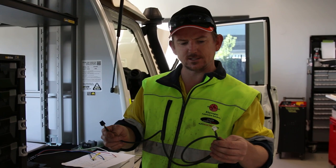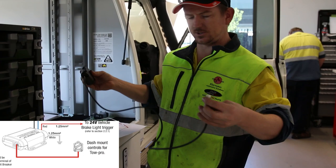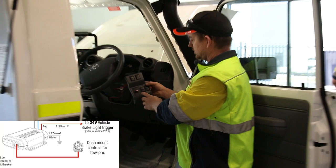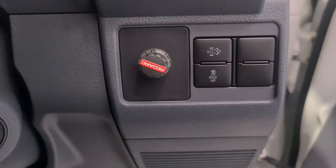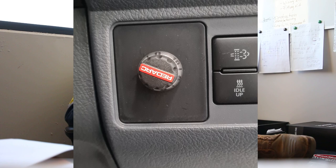That's basically all there is — four wires. On the other side you've got your hideaway dash connector which connects straight into the other side of the unit, clips in like that, and then that unit plugs into your dash dial which just goes into the unit here. It's all hidden away, and then you've got your dash display where you can set the brake force and change the mode you are in.